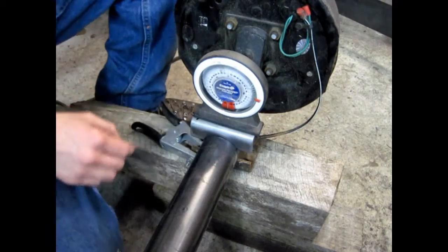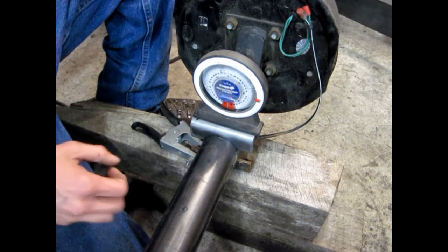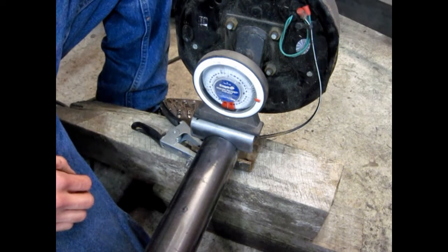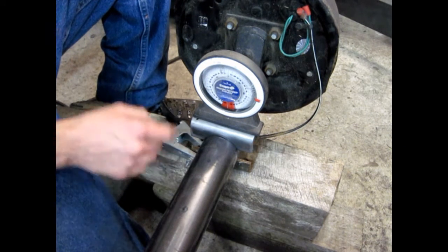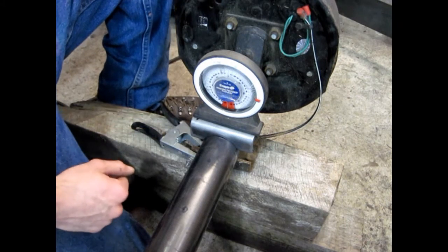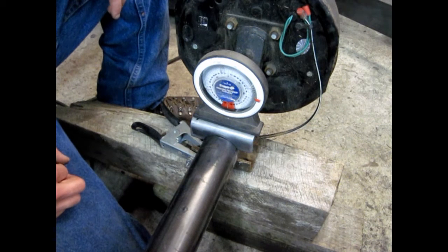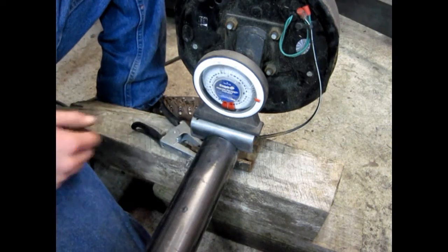I've got the perch mocked up on this side and I'm getting ready to tack it on here. I thought about bolting everything back up under the trailer and then welding the perch on just to make sure I got it in the right spot, but I really don't want to drag my welder all the way out there. What I did is I used my inclinometer, measured the angle of the bottom perch — not an exact science, but pretty close — and I'm setting the top one at the same angle. Whoever welded the old perches on here did a crappy job; they just got a cold weld. The weld on the other side broke, so I'll use this side as a base for the other side.